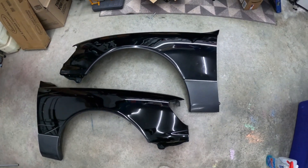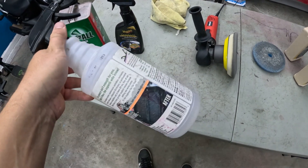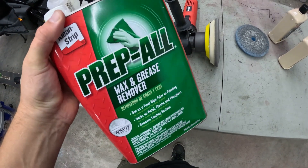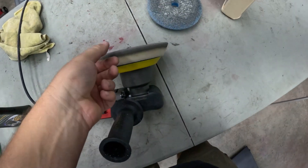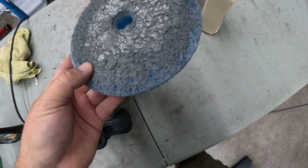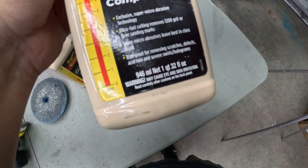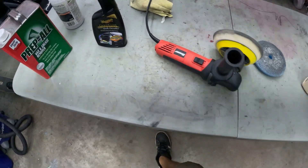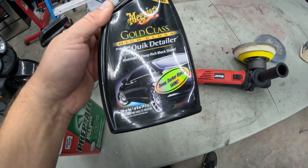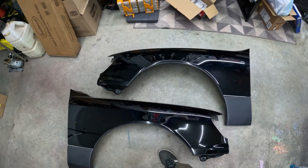Just a few minutes on this junkyard fender — look at those, they're dripping wet. They look like they just came out of fresh paint, but no, these are junkyard fenders we pulled off a 2000 LS400. Here's what I used: dish soap and water mixture in a spray bottle — I hit it all with a prep ball to get the grease and grime off. Then we hit it with the dual action buffer. I used a coarser pad on the driver's side fender because it had more scratches, then worked down to a fine pad. Ultra cut compound first, then ultra finish compound — links in the description. And then the black car spray detailer to finish.